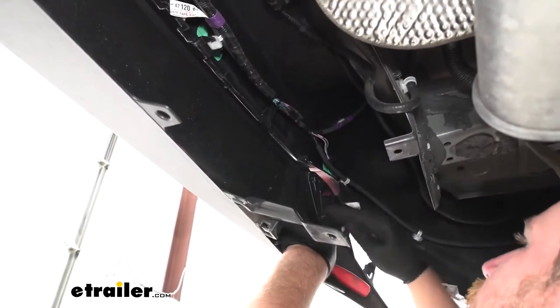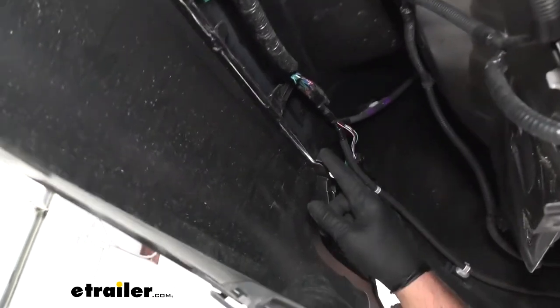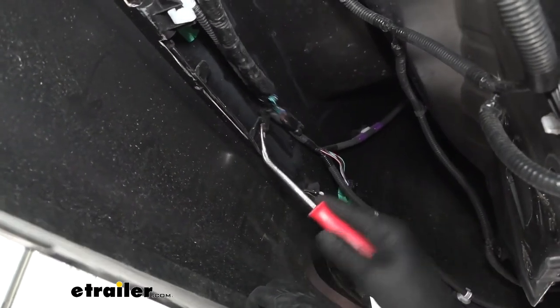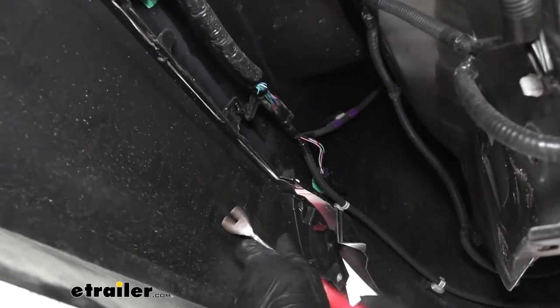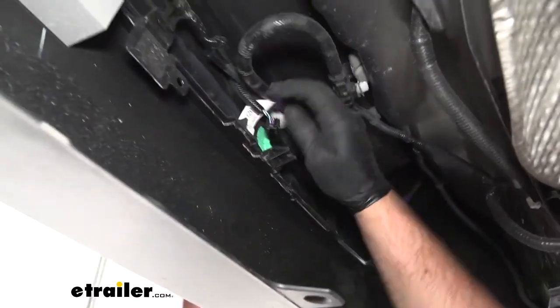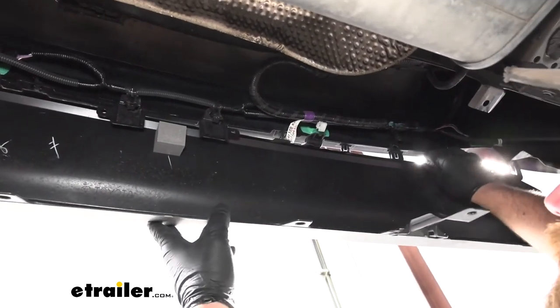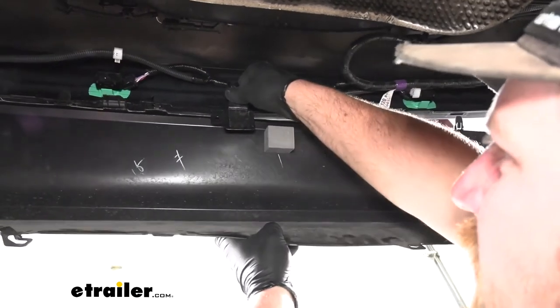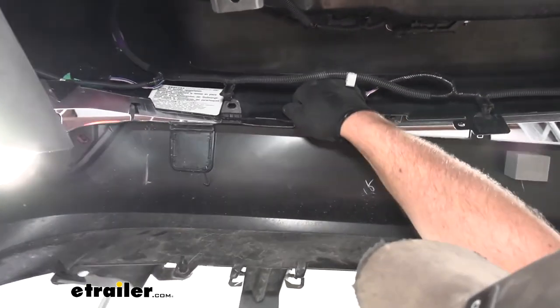With the bumper beam out of the way, now we can actually completely remove this lower panel. Just like many of the other types of fasteners along this whole edge all the way across, you're going to have several different types — something like this where your wiring is connected, and also some of those white sliding type fasteners as well. So just like we did before, we'll simply just work our way across that edge and get all these removed. Once you have all the clips and fasteners out, you can start to lower the panel and push in on those types of fasteners until it drops down, then set it off to the side.